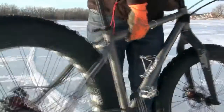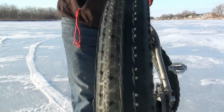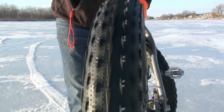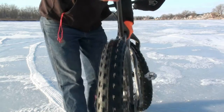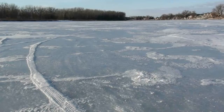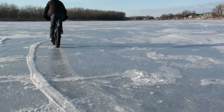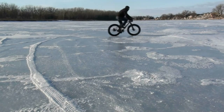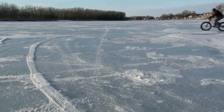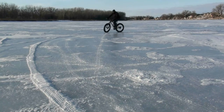For serious riding on ice, I use my big fat tire studded with half-inch number 8 lag screws. You can see this on a previous video done in 2013. These are screwed in from the inside out and are absolutely great for ice — they absolutely won't slip. On long stretches of pavement they slow me down and will wear down pretty quickly. That's why these set screws are a good alternative when only occasional ice is encountered, which seems to happen quite often this time of year. Thanks for listening.